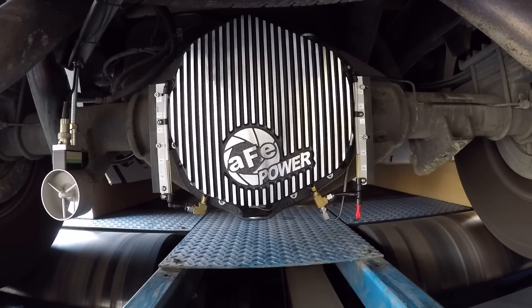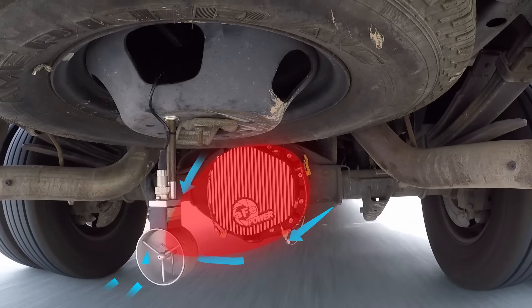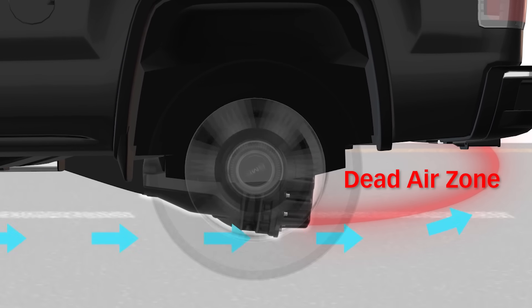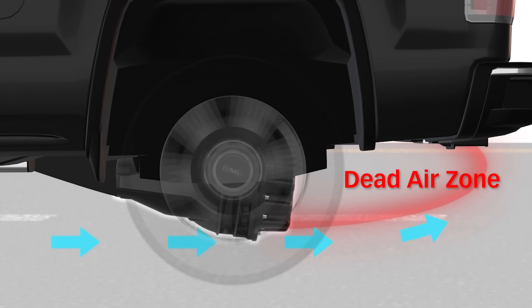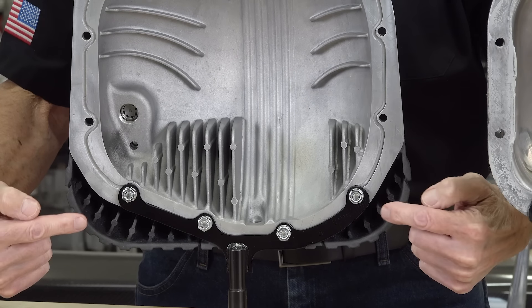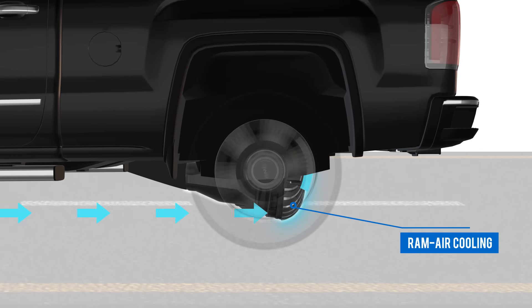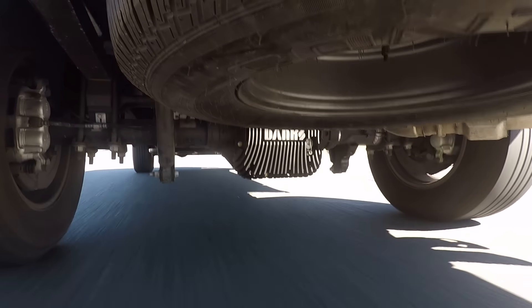So how do you cool the lube? Airflow — you need high velocity, cool air over the cover. The first thing we did was instrument the truck with several anemometers to measure the airflow under the belly and behind the differential. When we were out on the highway, we recorded temps and air velocity. We noticed a dead zone right behind the face of the diff cover — a large low-pressure zone. The differential housing splits the air like a wedge, and this low-velocity dead zone extends as far as 36 inches from the back face of the cover. This discovery resulted in our patented Ram Air design, where cool Ram Air is forced into the scoops and directed 90 degrees up and through the long, thin heat radiation fins.